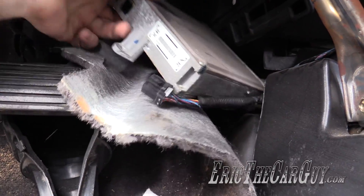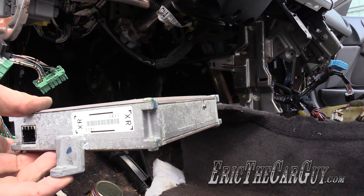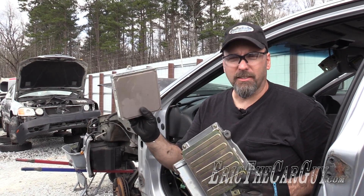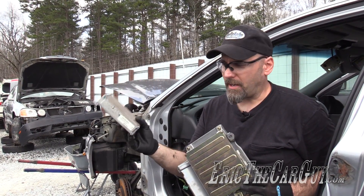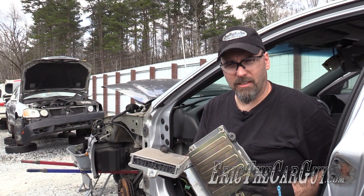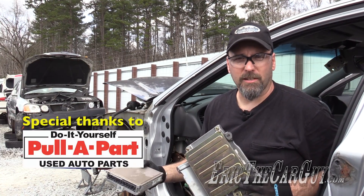But if you come out the driver's side, you'll have to work past the pedals. And there you have it — computer in Accord, TL, later models. It's worth pointing out that on these later models, the transmission computer and the powertrain computer are both located in the same housing. On the older Accords, located underneath the passenger floorboard, they are separate — this is the engine computer and that would be the transmission computer.